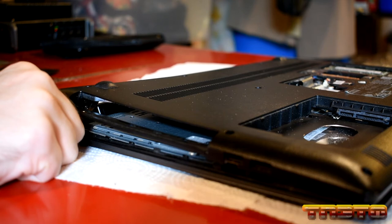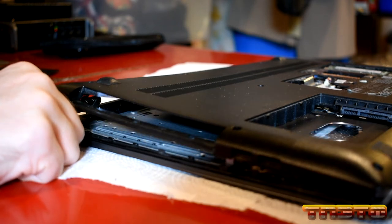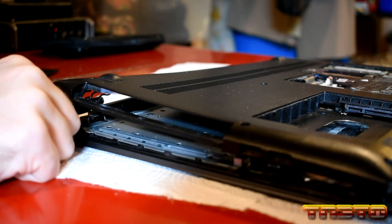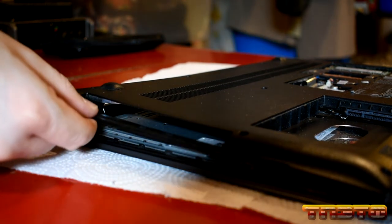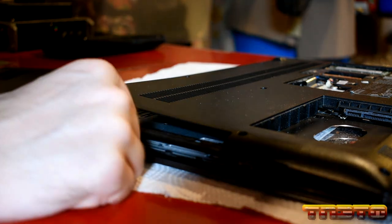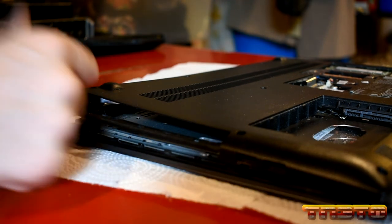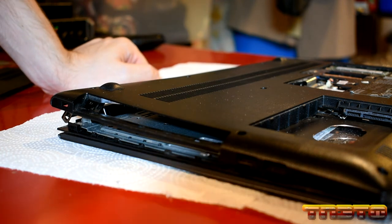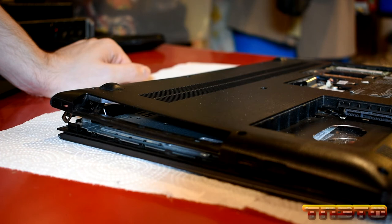You also have to be careful because there are wires going through the hinge — usually small wires for the webcam, webcam light, microphone, and sometimes Wi-Fi antennas in the monitor bezel. I'm checking these wires to make sure they're not severed — one looks a little iffy, but they appear intact. We do have some damage to the optical drive bezel — that's damaged. The actual screw holder is completely busted out. So the recessed barrel for the hinge has been busted, meaning you probably couldn't even screw this hinge back on if you wanted to.